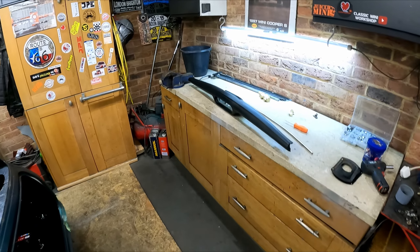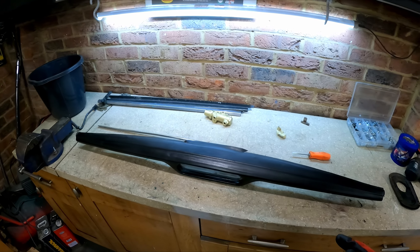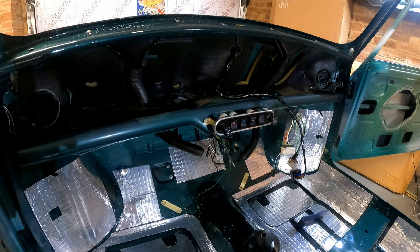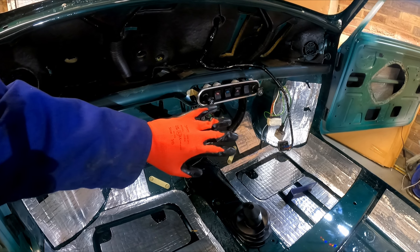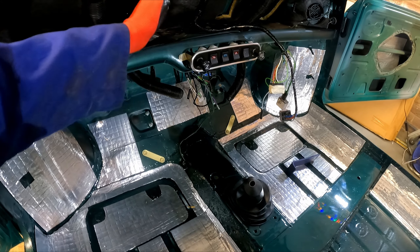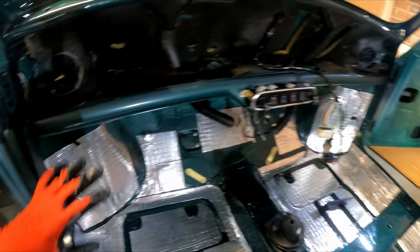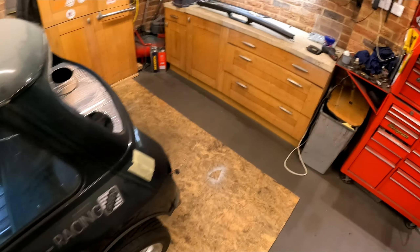Right, one thing I did get asked by a subscriber was to show how this bottom dash pad goes in. I had actually fitted it but I took it out again so I can show you. That's the lower dash rail. I'm not sure whether you're meant to, but the last couple of times I've done this on Minis I've just put the switch gear in place and you can get the dash pad on with the switch gear there, because it's a real pain once that dash pad's in to get everything connected up and get these bolts tightened that hold the console in with all the switches and get all the cables through.